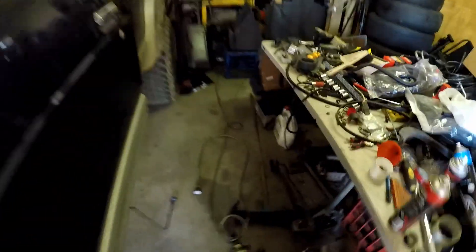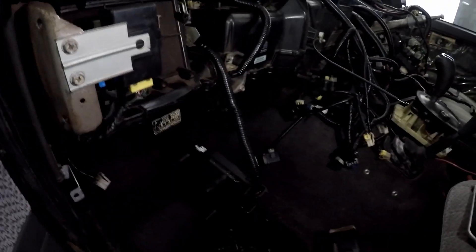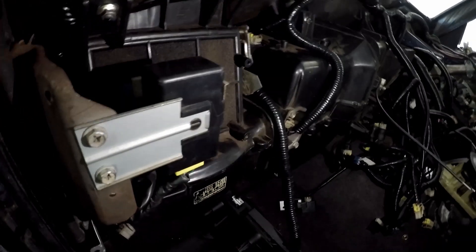That connector down there goes into the car — I put a hole into the firewall, and then it comes out underneath there, and then it goes up and over the actual heater boxes. That's the air-con box, so it's not actually going to get hot. These are just currently dangling here, so they won't actually be in that big piece — it's just there for now. But yeah, that will just be tucked up under the dash and you won't ever see it. Hopefully pretty high up — that's why I went over the top, so I can get it as high up as possible.